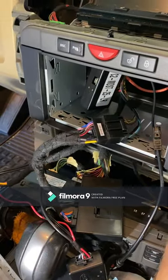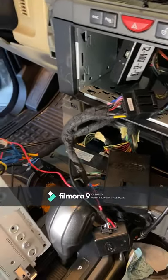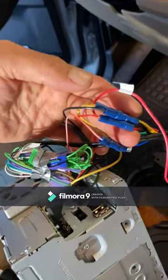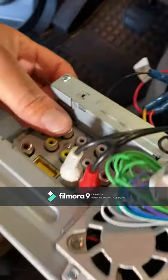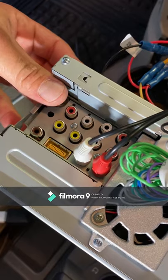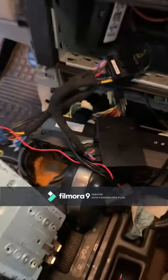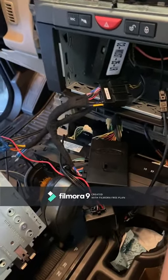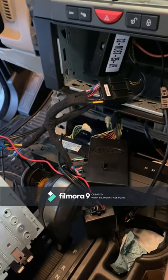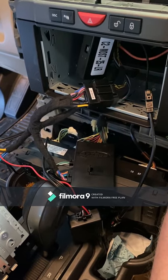I'm going to show you the video of everything installed. This is obviously the first part of the video. Really all you're doing is connecting butt connectors to four cables and then plugging your RCAs into the front amplifier ports of the aftermarket radio. I couldn't find even a write-up on this — everyone is tearing their stereos out and destroying them because you really need this Access kit for it to function just like stock.